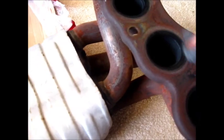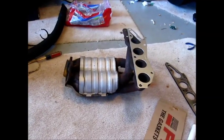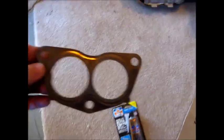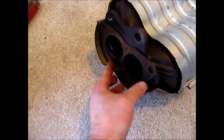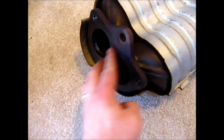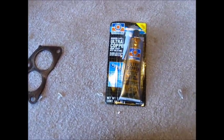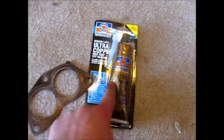You're going to want to get a new set of gaskets. You want to clean up around the area — I'm going to use some steel wool and a shop vac. Just clean this up so the shims will seal nicely around there and the seals will be tight. I was able to get the top gasket, but this bottom one is called the exhaust pipe flange gasket and it goes right there. I'm going to have to reuse the old one, so make sure this end is really clean — use steel wool. I got this high-temperature gasket maker; it goes up to 700 degrees and it's oxygen-sensor safe. I'm going to add some of this to the gasket itself to help make sure there's a really good seal.